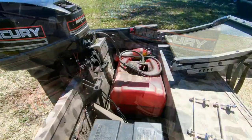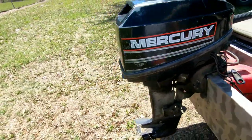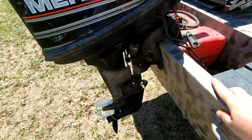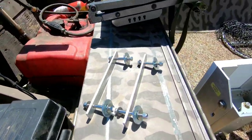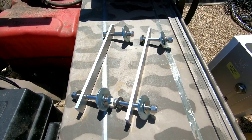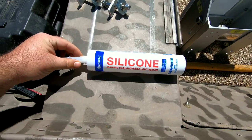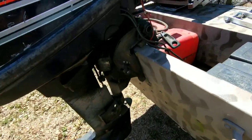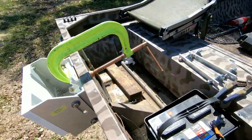The first thing I had to do is remove my outboard from the boat. This is a '99 Mercury short shaft on a 16 inch transom, inch and a half thick. I've already got my transom stabilizer brackets cut out of quarter inch aluminum, one inch wide stainless bolts with extra large fender washers for wood support. I have Star Brite marine grade silicone to go behind the jack plate to help seal the holes through my transom once installation is complete.